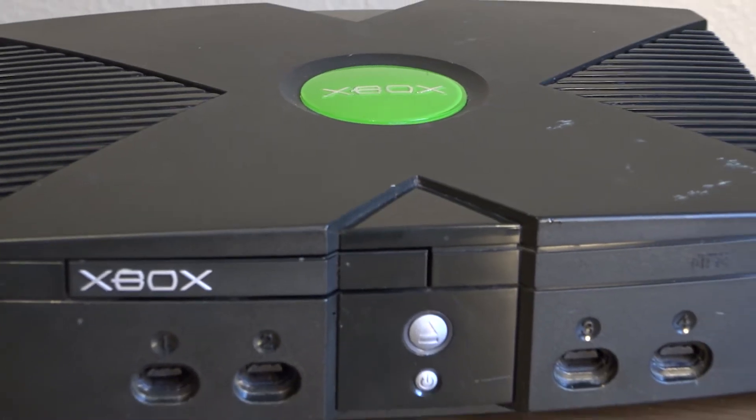These versions were equipped with a faulty capacitor. A capacitor is basically a rechargeable battery. The purpose of this battery was to save the date and time on the Xbox if the unit was ever unplugged or the power went out. Unfortunately, this capacitor degrades over time, slowly leaking an acidic substance onto the board, which will eventually eat through the components, breaking the Xbox permanently. The fix is simple — we just have to remove the capacitor. This is easy. You can do this.